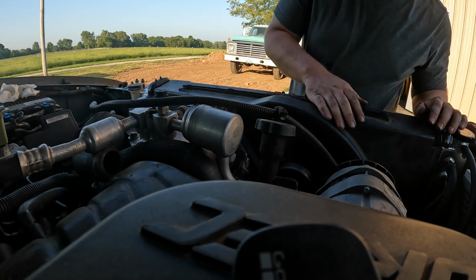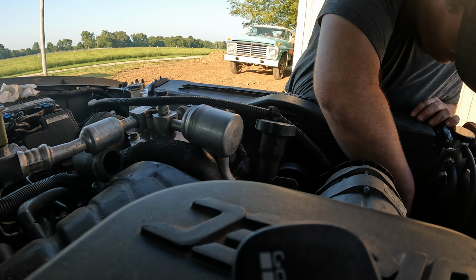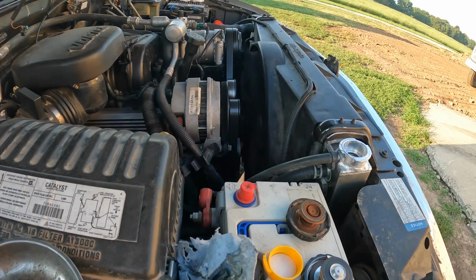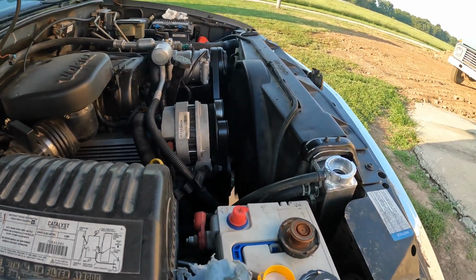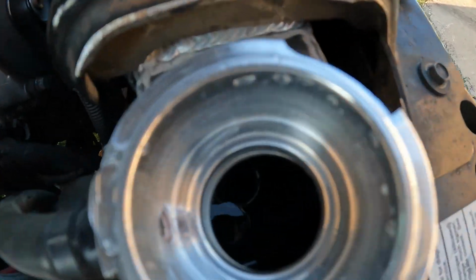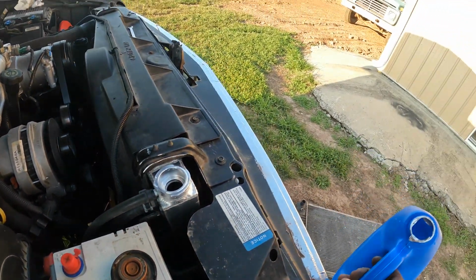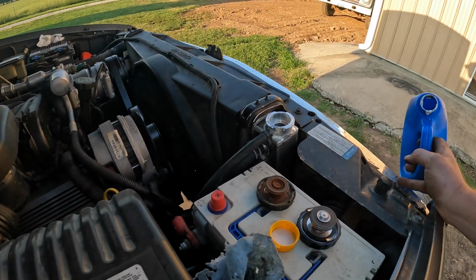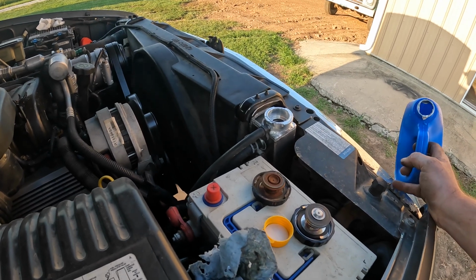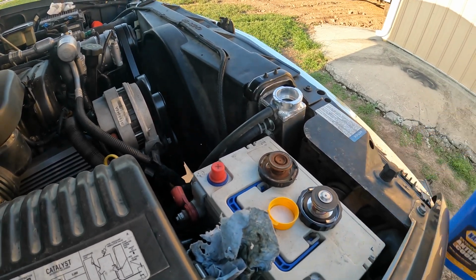That one we're all washed. Okay, it even fits in there. Got the truck running, fan shroud and everything all installed. Gonna add some more water. It went down a little bit. Gonna go ahead and get the cooling system to burp a couple times, and then we'll call this thing good if it doesn't start puking antifreeze out everywhere.